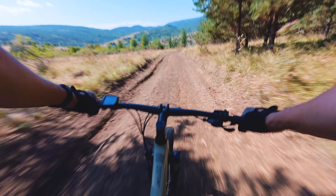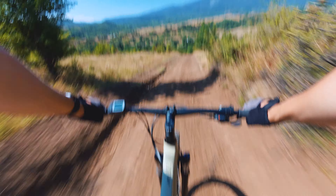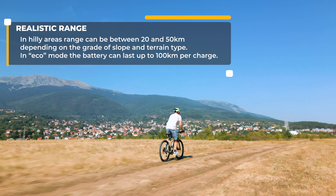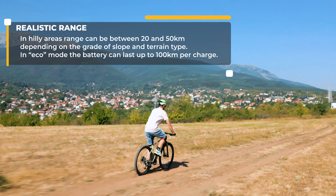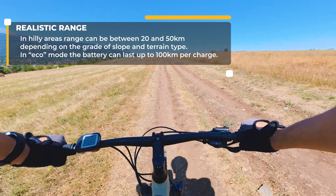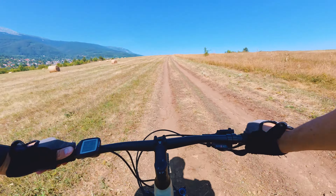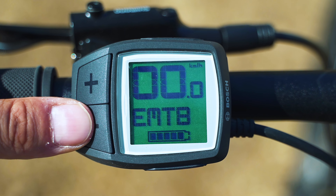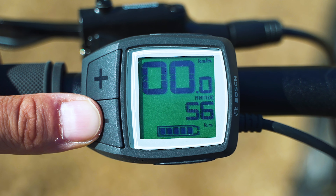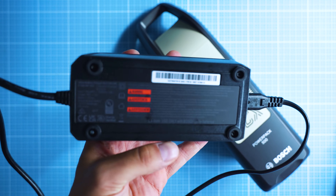As for range, there are a lot of variables. They say up to 90 kilometers realistic range. If I'm lazy and going uphill in the mountains, the worst I've ever had with the Bosch motor is about 15 kilometers with crazy elevation. On the other hand, I've had achievements close to 200 kilometers per charge with much more pedaling from my end. Realistically, 50 to 80 kilometers is what most people would get on flat roads — and it's going to be less in the mountains. I strongly recommend checking the range estimation on the display for each support level; it's very trustworthy information.